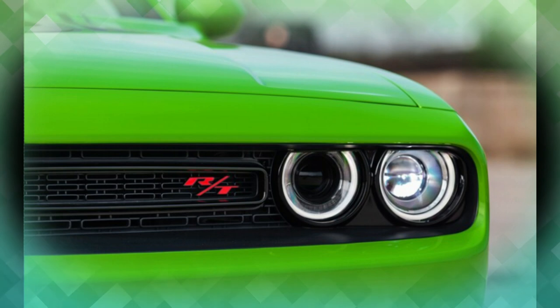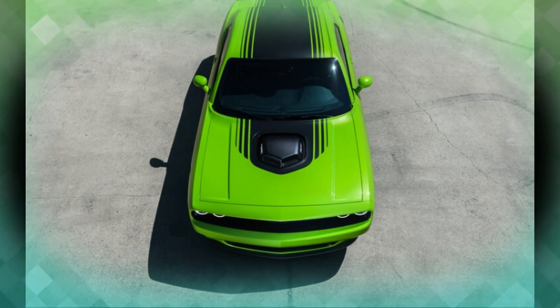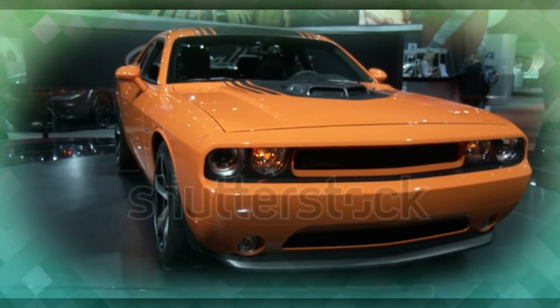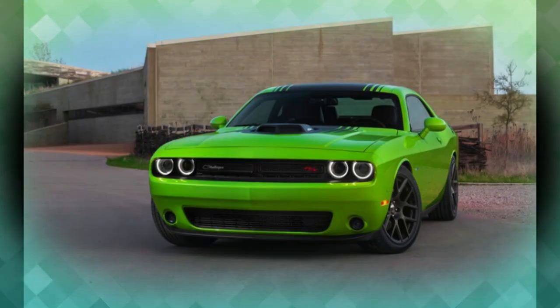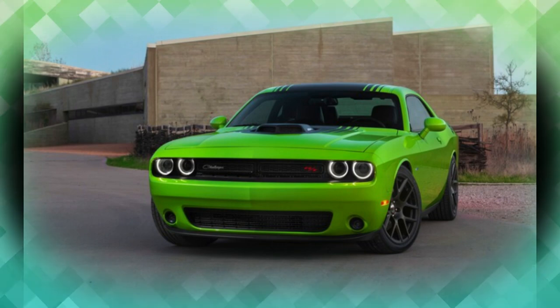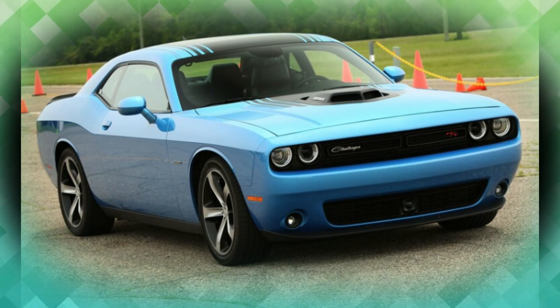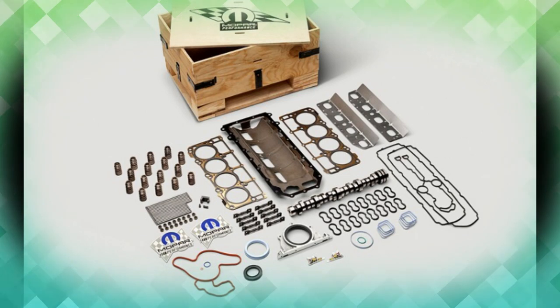Scat Pack 2 is the time-consuming one, as it involves some mild open-heart surgery, with the cylinder heads coming off to get a hotter camshaft, pushrods, and performance valve springs with tie bars to reinforce the rocker towers. The benefit can be as much as 56 horsepower and 30 pound-feet above the stock engine. The one big hitch is that realizing that power requires an ECU reflash that is not provided by Mopar — the recommended vendor is Aero Racing — and that is not emissions compliant, so think twice before installing this if you plan on driving the car on public roads and if it faces an annual smog test.